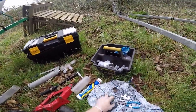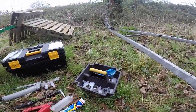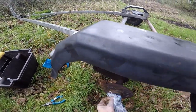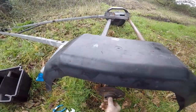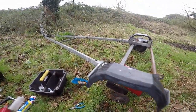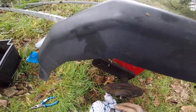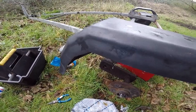Using a bit of rag I can just clean it all up a little bit. We have what's called a castle nut — these do tend to wear a bit, so it's probably worth replacing if you haven't done this for a while. When the nut's tightened up, to stop it from moving, the pin goes through and sits in these grooves. One of the good things about this axle is there are actually four holes drilled through the middle, which allows a lot more tuning for when you actually put the wheel back on — which is important.